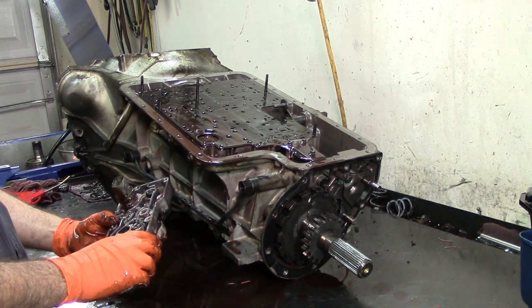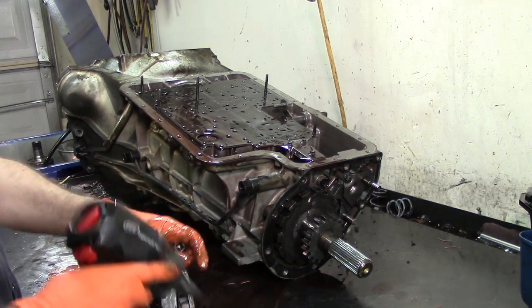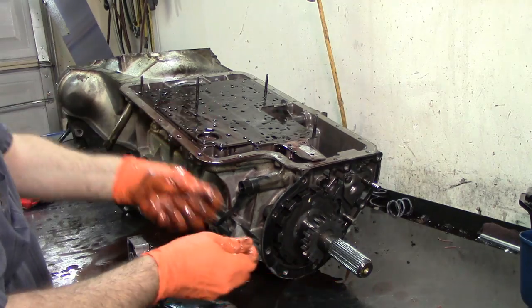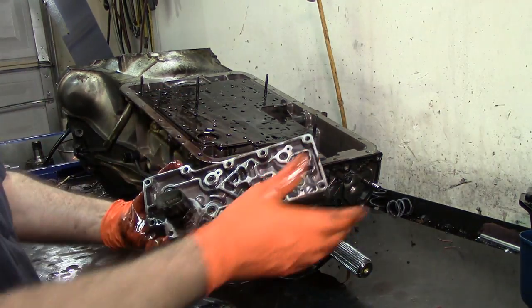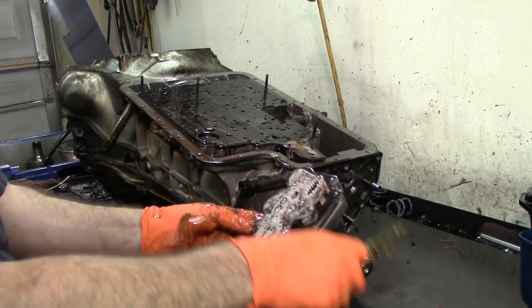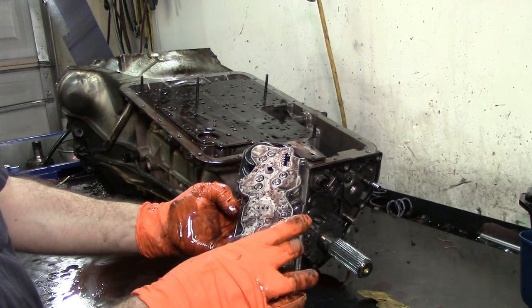Let's wait until the compressor shuts off so you can hear what I'm about to say. Let's take these three little bolts to take that plate off. This is very important that it's on there and tight — if that plate or those three bolts are loose you're not going to have any reverse. Back to our solenoid pack: this is a pulse-width-modulated torque converter clutch apply solenoid pack. The way you identify it — even if it doesn't have a cover, because this cover is removable — sometimes you find them like this, or you get rebuild ones where you can see the green circuit board.